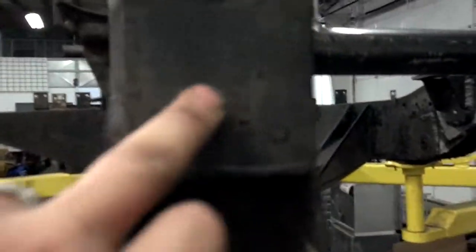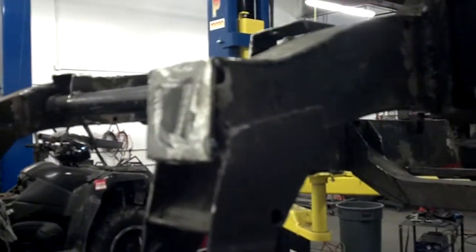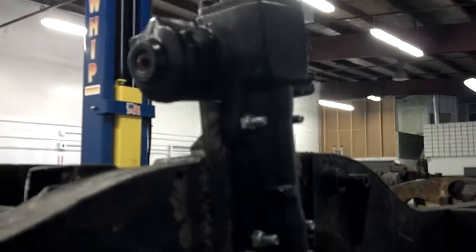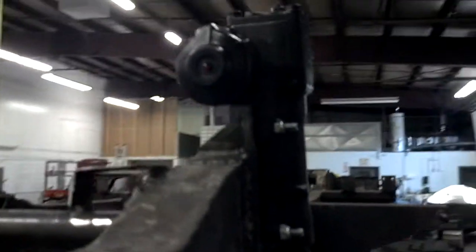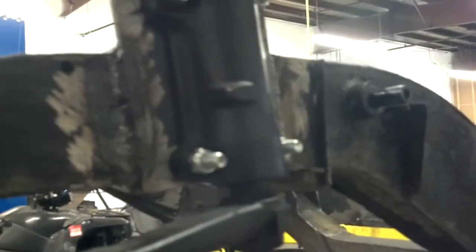As we get up in here, you're just going to hit lots of areas. We had some spots that were really bad on the other side, so I pulled that off and chopped it off last night, and we're putting on a new plate here. And a really nice P-38 mounting assembly — you can tell what we've done here with respect to welding the bolt heads on. Then we just drilled holes in the frame, strengthened up with a stiffening plate, and we're able to accomplish the same thing.